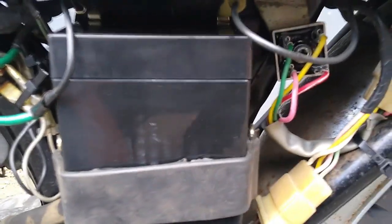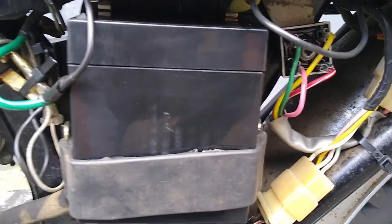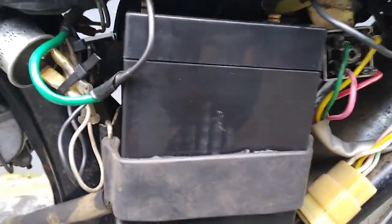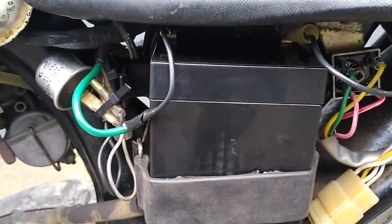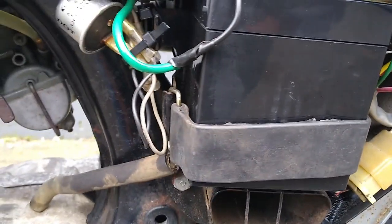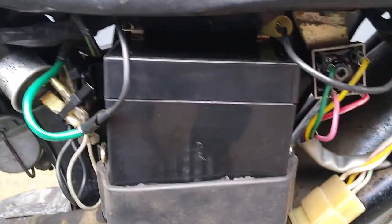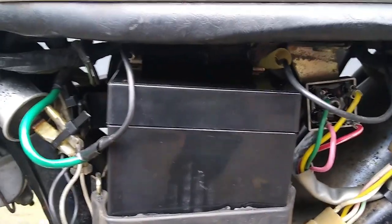This is the 12 volt conversion. I've got a bridge rectifier there. It does run a little bit high, so I might try to wire in a regulator at some point. Right now I'm running this with an AGM battery, so it can kind of take that, unlike a lithium, but ideally we would keep that voltage under control. Right now it's jumping all the way up to 15 volts.